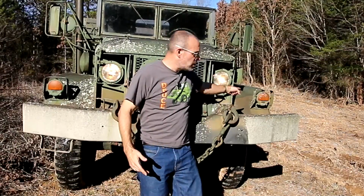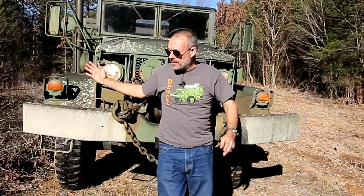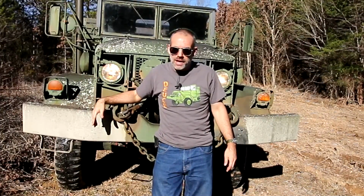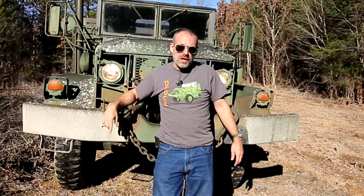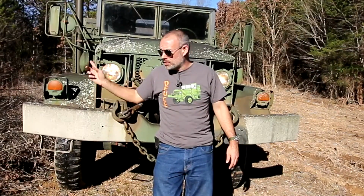flashers. I've got one good turn signal, and unfortunately up front I've got one bad turn signal. I don't have a bulb for it yet because it's a 24 volt system. You can't go down to Walmart and buy that, so I'm going to have to order that, and that'll be a future video. But right now let's talk about the turn signals and how I fixed mine, because mine was broken, even more so than it is now.